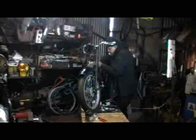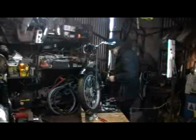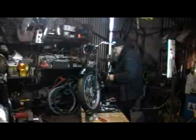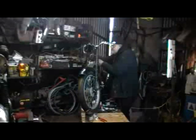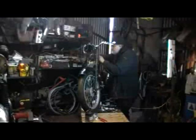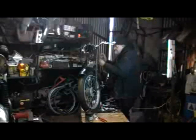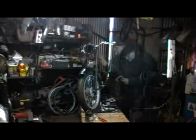James Cadet part six — I'm doing the wiring. You've seen me do this before; it's literally taking wire and putting bullet connectors to each individual item. But on this bike it's a bit of a mismatch: the frame suggests there should be a battery, but the headlight switch suggests there shouldn't — it has the earlier headlight switch which ran directly off the magneto. So I have to build a wiring loom that does a little bit more than the earlier version but not as much as the later version. Here you can see me connecting up the wires, adding an extra circuit for the brake light and an extra power source for the horn, earthed out through the handlebars.